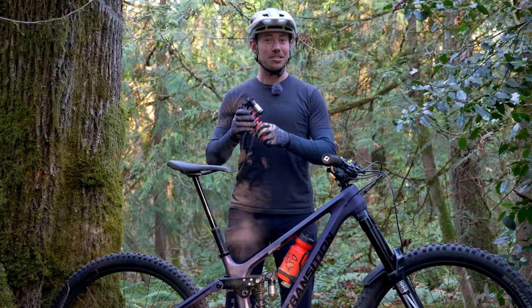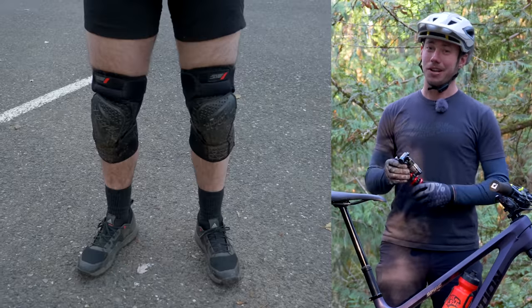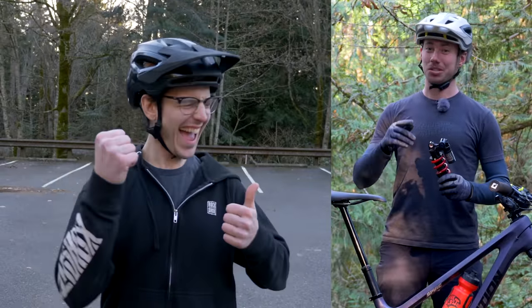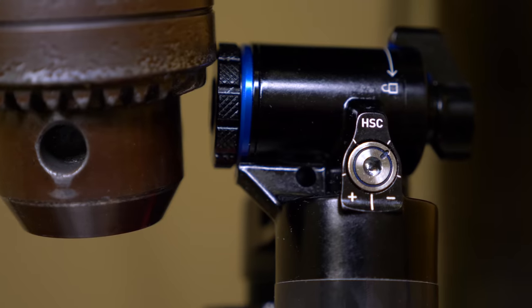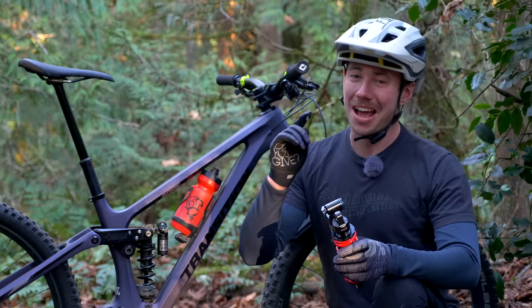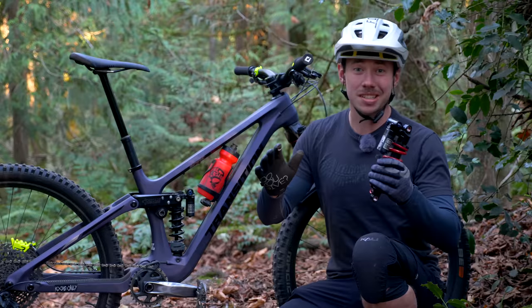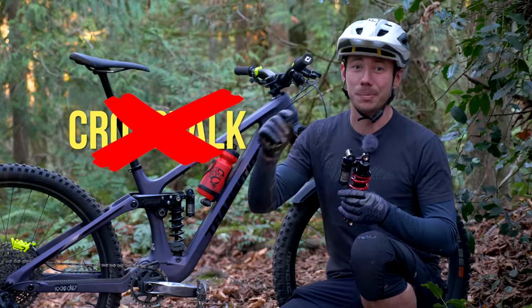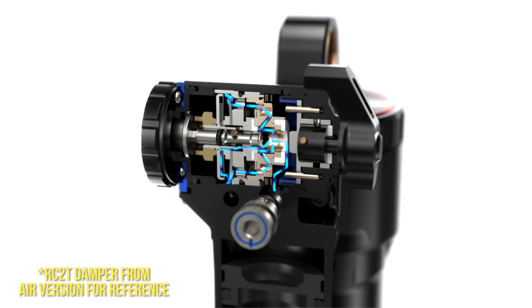With so few clicks, it's easy to assume that you won't have the range of adjustability to tune your suspension to be buttery smooth, but you're wrong. RockShox has struck a balance between a wide range of adjustability and a usable number of clicks. You don't have to go two or even three clicks to feel something anymore — every single click is going to have a direct impact on how your shock performs. RockShox has also claimed to have eliminated what they call crosstalk from your high and low speed compression, meaning adjusting one of them won't influence the other.